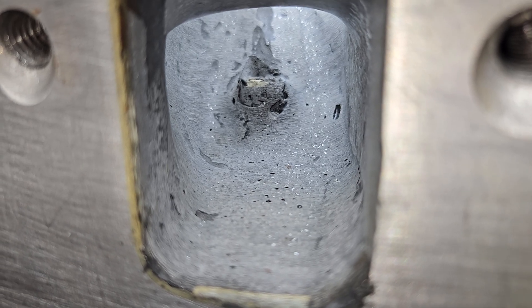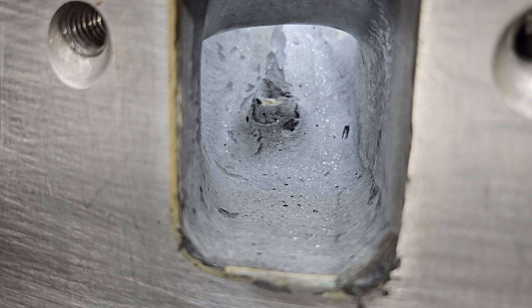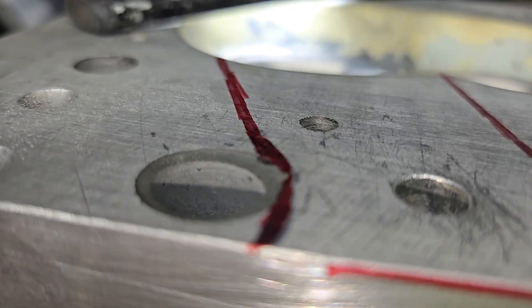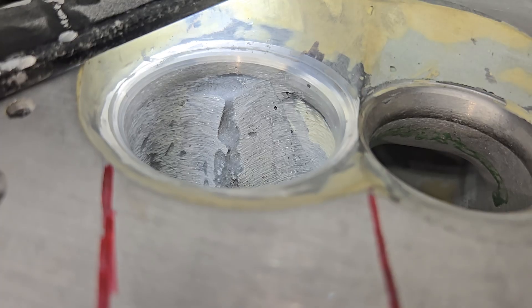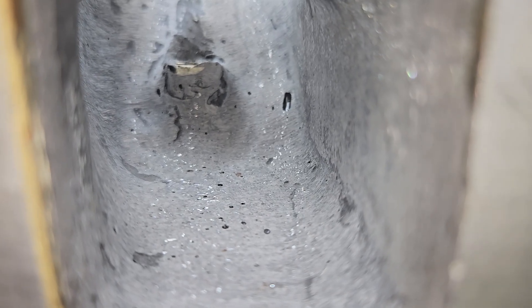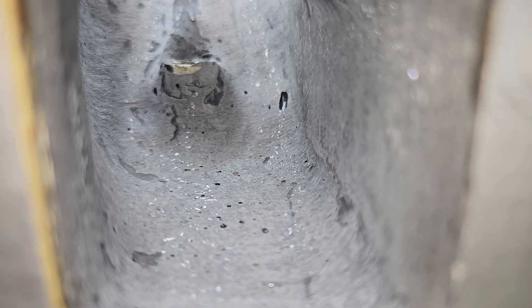It's still doing pretty well — we're going to show you the flows in a minute. As of right now I am keeping that fin in the bowl pretty much in the direction of the port itself. It could use some more work, but I'm definitely going to have to put a little more epoxy on it to get where I want it to be. Right after I get off making this video I'm going to mix up a little epoxy and see if I can make enough to put a fin. I also have to fill the side of the bowl and work on that part of the fin.